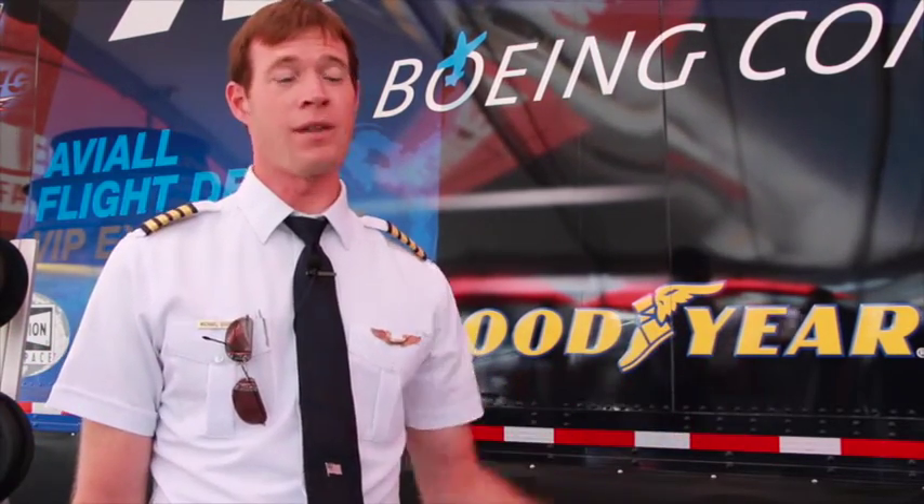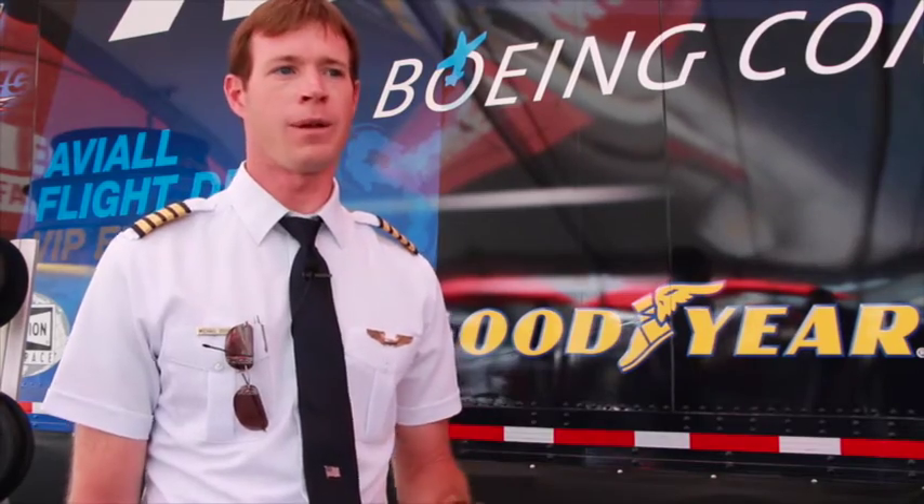Wingfoot One is pretty different from the old airships. Three engines make it much more capable, and the engines being Lycoming IO-360 engines, specially adapted through a 90-degree gearbox, spin about a 9-foot, 3-bladed propeller that's full vectoring and fully reversible. It can vector up to 120 degrees on the forward engines and down 90 degrees on the aft engine — fully forward and reversible controllable pitch propellers — which give us the ability to take off and land basically like a helicopter in this airship.